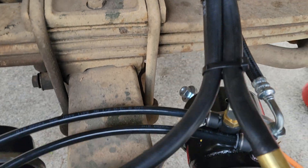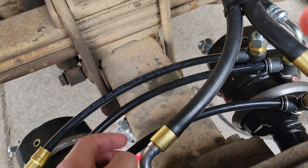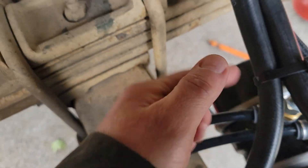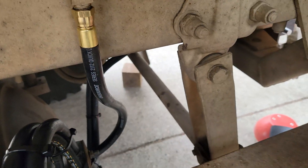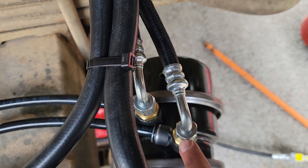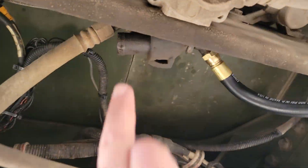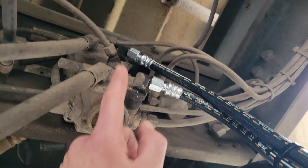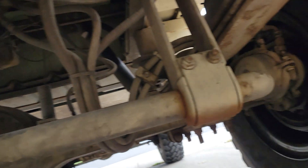I got all the routing done and the hose block reattached. You can always do one side at a time and look at the other brake chambers for reference. This is your CTIS which comes down and goes up under there to your CTIS valve. This is your vent which comes down and lands right here. Then you have lower and upper. Under the truck: this one here is your CTIS valve, this is your lower, and that one up there is your upper. Your vent is right there. Pretty simple - got to bolt all this back together and then start on the other side.